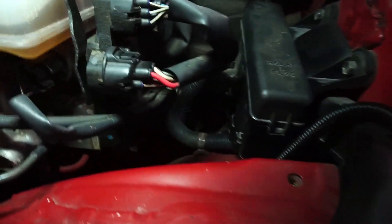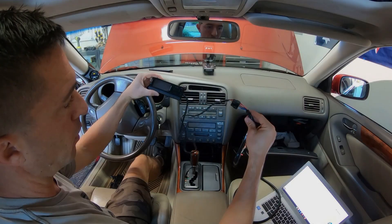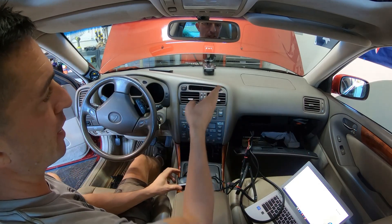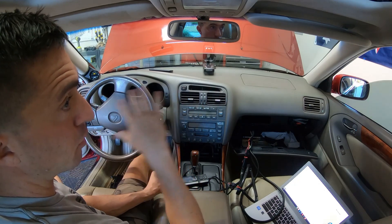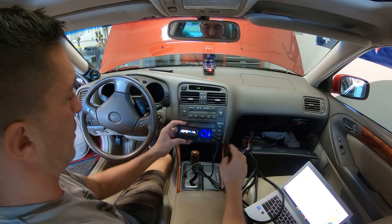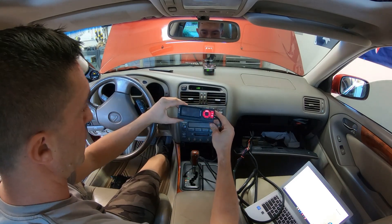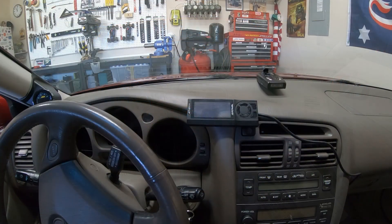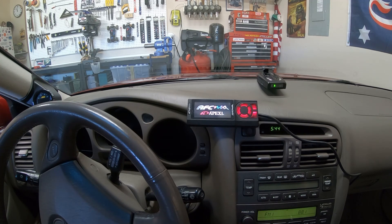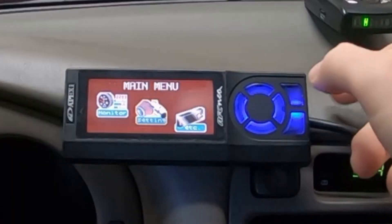The NEO is all hooked up. Now put your negative cable back on the battery and turn your key to the accessory position — do not start the car. It's all plugged in, accessory position. Once you have the Apexi NEO wired up, I want to walk you through the steps to set it properly so you don't fire up your car and have a bunch of problems. First set your key to the accessory position, and you'll see the main menu when it boots up.